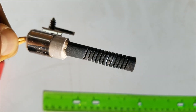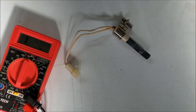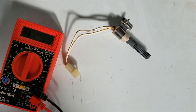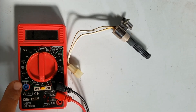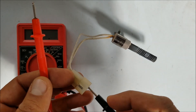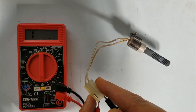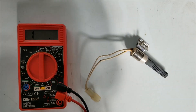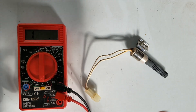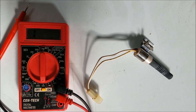I did see on another message board a warning that you may not experience these symptoms every time. So you can get your voltmeter - I have this free Harbor Freight one - set it to ohms. This is just a resistor, just like any light bulb or electric igniter. Put the contacts on it: you see there's infinite resistance because there's nothing completing the circuit. When it's good it should show resistance because the circuit is complete, but once it burns out it is not complete. I also tested it by putting a light bulb up to it to confirm how it should function.